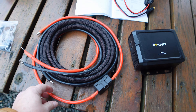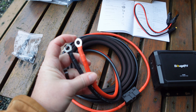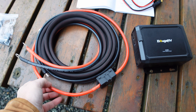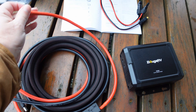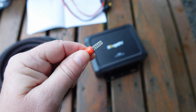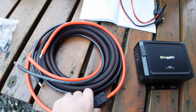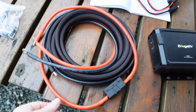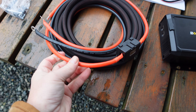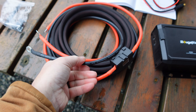They also provide a five-meter cable to go from your battery. You've got a couple of ring connectors, and you wind that through your vehicle and connect it to the DC to DC charger with these inputs that are already pre-tinned. It reminds me of the BlueEtti charger I reviewed not long ago — looks like a similar type of cable. Six gauge, nice soft cable, probably fine-stranded wires making it very flexible and easy to wind through the vehicle.